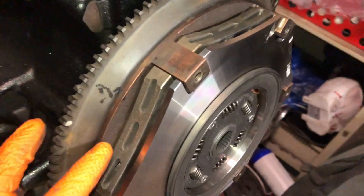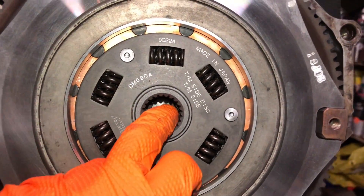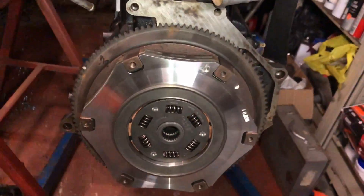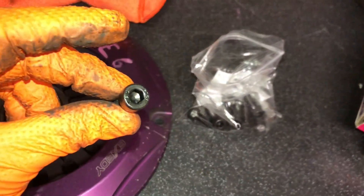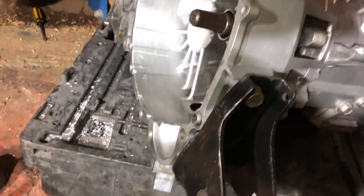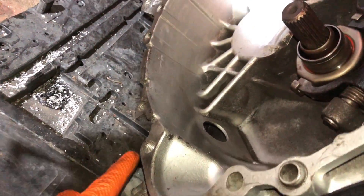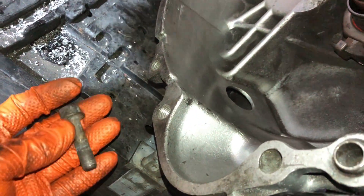There you go, that's all the clutch fitted. Just got to put the cover plate on top. You've got to make sure that these clutch plates are aligned perfectly because the main shaft's going to go through there - and it's not just about up, down, left and right centralization, all these splines in there have to be aligned as well. So I've got to put an alignment tool in there. I also bought a bag of clutch plate bolts - they're 12.9 tensile socket head bolts, might as well use new ones. But when I pulled out the old bolts, I found that one had stripped the threads in the aluminium bell housing. So I've just drilled it out and tapped it to M12 thread so it's even thicker and I'll put a stronger bolt in.